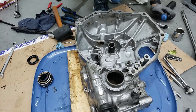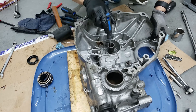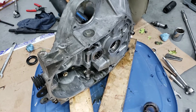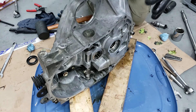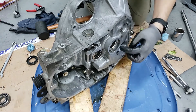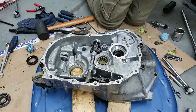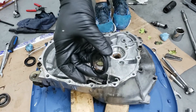Alright, for pounding out the input shaft bearing that's pretty straightforward. You get your throw bearing out, and then right in here you can get a flathead screwdriver onto the edge and just tap it out. It'll come right out gently, as you can see, and you can get the rest out with the transmission standing like this. From the sounds of it this bearing is actually not bad — it's not noisy at all. The input shaft bearing is technically still good, but while I'm in here I might as well replace it. Inside here there is also a seal — just pop that out with a flathead screwdriver or a seal remover tool. There we go, got the seal out — we're replacing that as well.